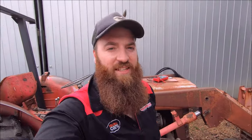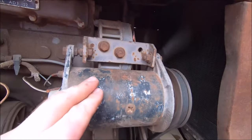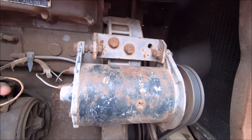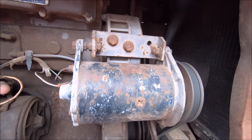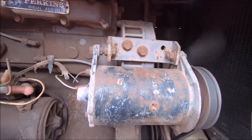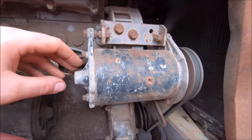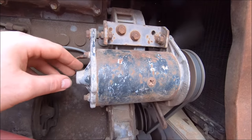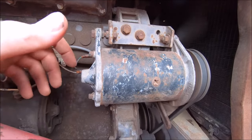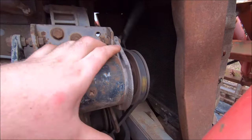So what that tells us is the generator isn't putting out enough charge to keep the battery charged. We tested at the battery and confirmed not enough power is getting there. We also tested at the generator and confirmed it's not putting out enough charge — so we can eliminate a wiring or connection issue. I believe the generator isn't charging well because, compared to an alternator, the brushes contact differently and wear out a lot quicker. The higher you rev it the better the charge, so that supports the brush theory. I can also feel a knock in it and you can see the pulley is a little bit wobbly.